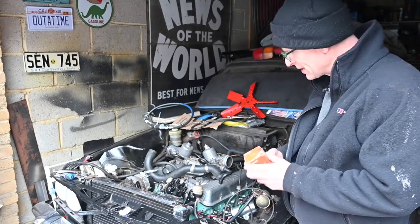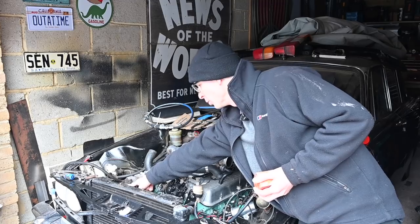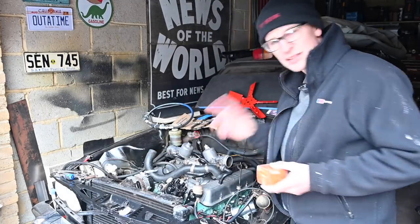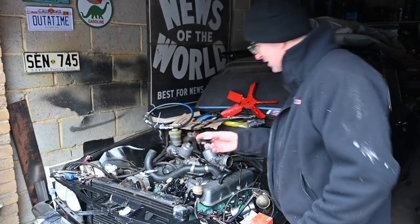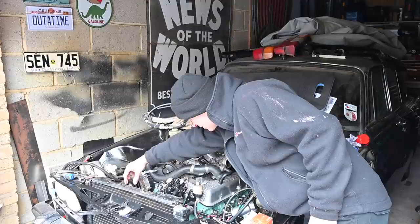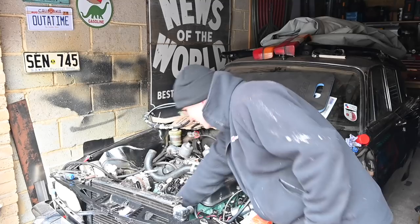Secondly, I've been waiting for a solution to my alternator pulley not being in the right place. I think I've figured that one out — there are different kinds of alternator pulleys depending on the application. This one has literally just arrived in the post and I haven't measured it up against the car yet, but I think that with the washer it will be about right.